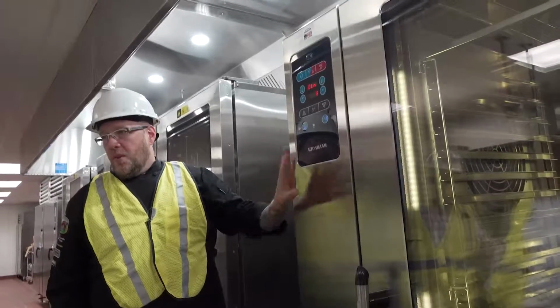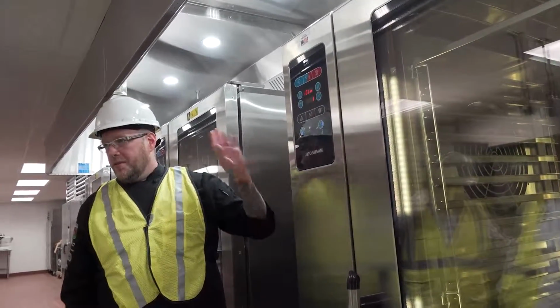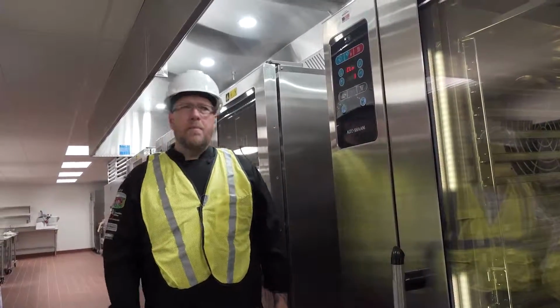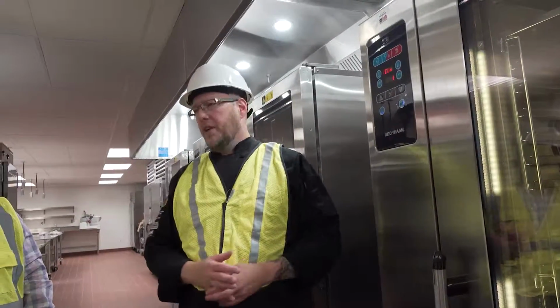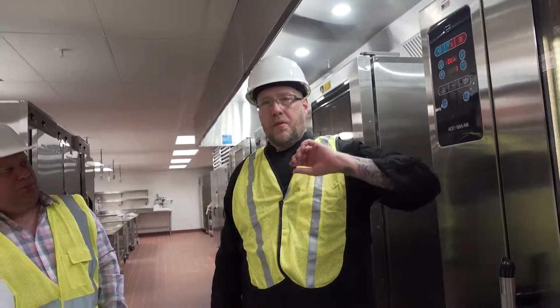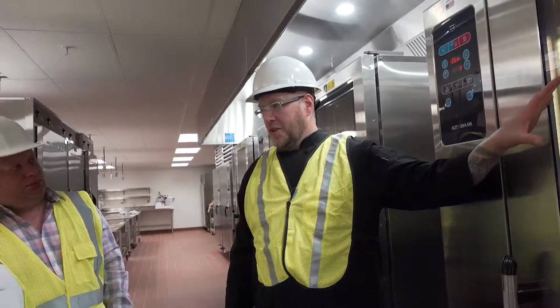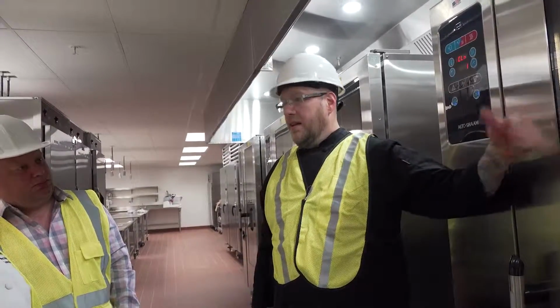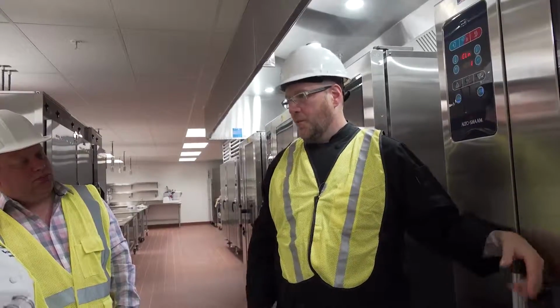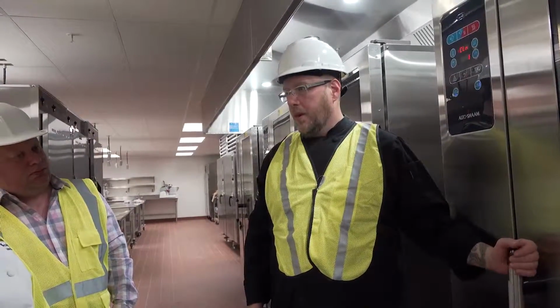The oven will go through its wash cycle and go to sleep afterwards, so you can clean it last thing out the door. Clean daily? If you're doing a lot of heavy grease, I would say clean daily. If you're roasting wings and bacon and skin-on chicken in here all day and it looks like a crime scene, then run the 6-tab clean. If you ran rice in here all day, it's just water, I wouldn't worry about it.